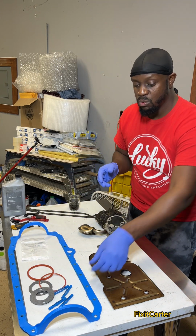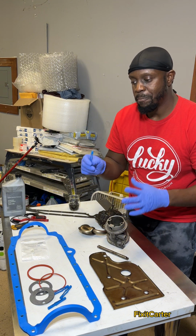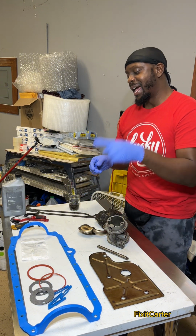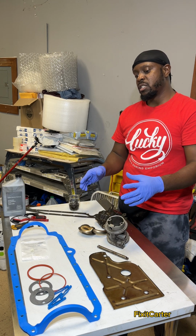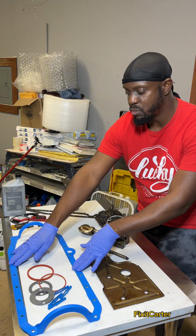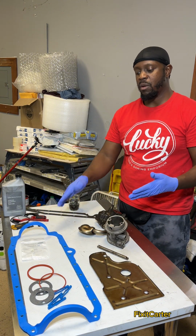Alrighty, so also comes with the gasket kit is usually these little brackets that hold the gasket up onto the block. The gaskets that are originally for this engine are metal gaskets. It comes in 4 pieces, so it'll be these 2 pieces, and then it'll be these two to mount up in there. It's not all one piece like this is.